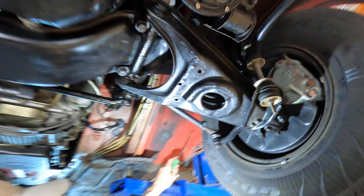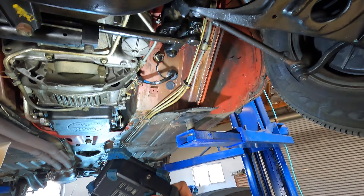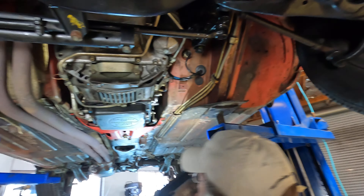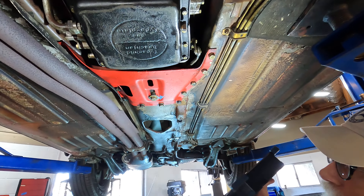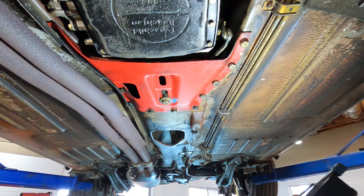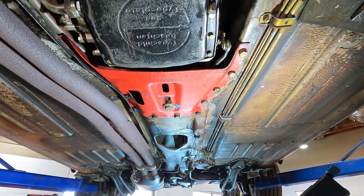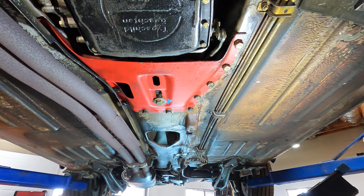Again, the wheel house has factory body color, and the lines are gold cad but were covered with cosmoline, so they've darkened over the years to more of a root beer color. The transmission mounting plates were always body color, and you'll notice little blue paint — that's what we call 'dotology.' When things were torqued, they'd put a paint blotch to mark it so the inspector would know it was done.